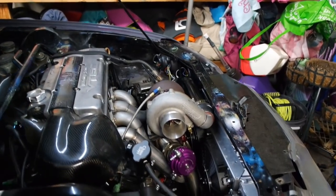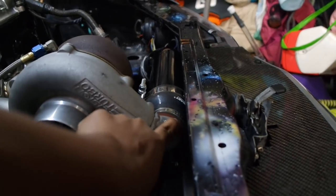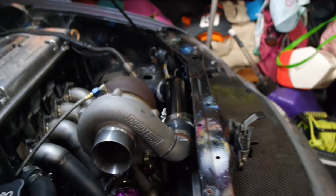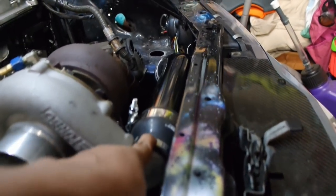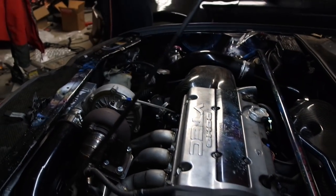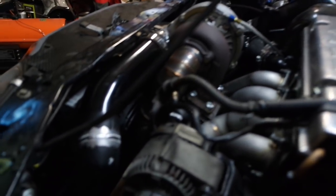Since the last clip it's been a few days — we actually had to order this Vibrant two-inch 90-degree turn because obviously there's not a lot of space. But the master fabricator came up with the idea: we can cut a little bit of the turbo outlet off, weld the 90 on there, and then it's connected to the coupler — one nice clean piece that runs down to the intercooler. Came out really clean, man.